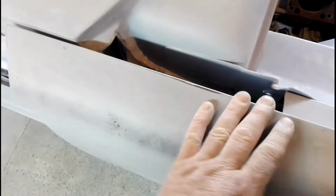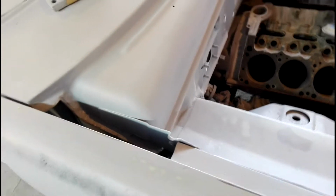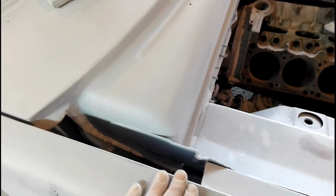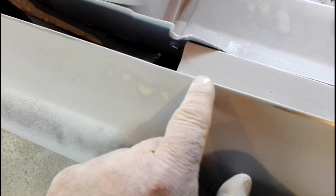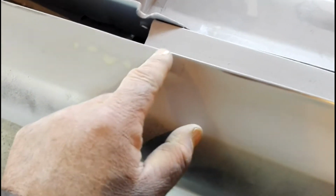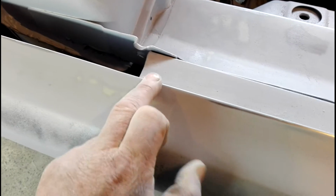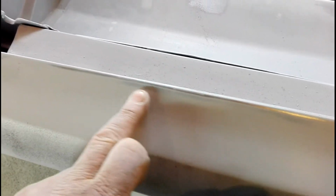Another couple of layers of high build will definitely take that up. And you shouldn't get back down to this, or if you do, it's very minimal, and that's just before your final block back before you paint. You've just got to mist a bit over there and be very careful not to rub back through to your steel before you paint. But again here, I've come up against filler, and there's still a few marks in there. I can feel with my finger there's quite a wee mark in that one, so maybe the paint would take that up, but I could just smear a wee squeak of that dolphin glaze in there to get rid of that before I put any primer over it. But down through here, you can see that it's still motley, and I can just feel it.